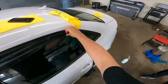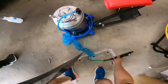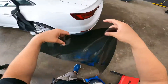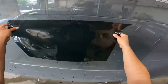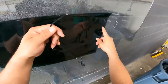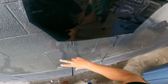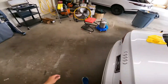Grab my film — my hose is right here, I'm just going to wet it. Make sure that the pattern is upside down. Now that I'm here, I'm going to release my liner. Always pull away from your cut line — so here, pull up this line, pull this way; this line, pull down. Beautiful. I'll turn this fan off.